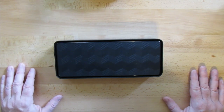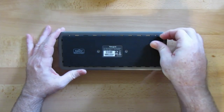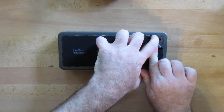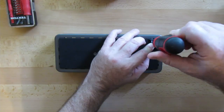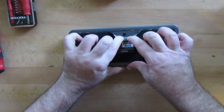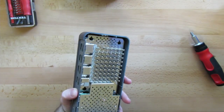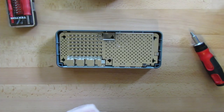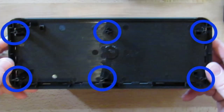Let's jump right in and take this dock apart and see some innards. The screws are located under the bottom, under the large rubber pad. There are 6 of them — one in each corner and two in the middle. Now that the screws have been removed, we can get our first peek at the inside. We can see a large metal RF shield with some heatsink fins. Also, the top of the case is where the screws from the bottom are attached — a simple sandwich design.